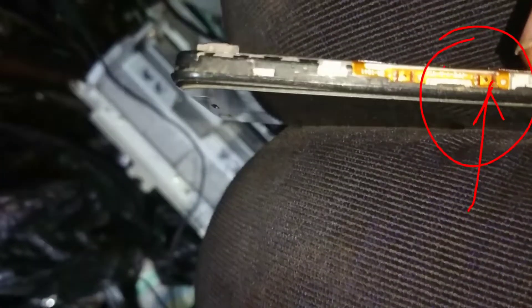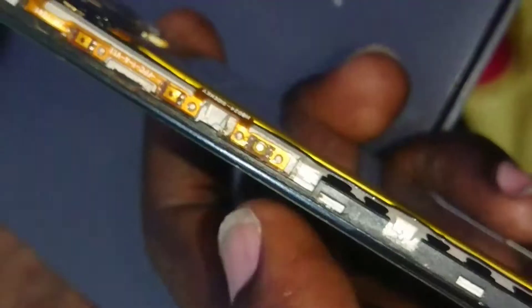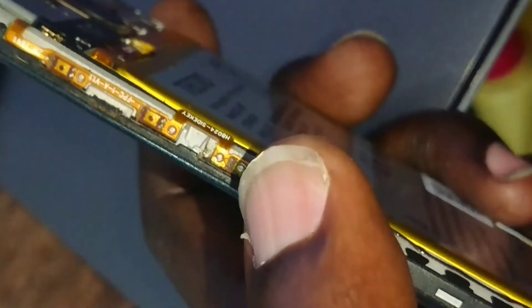I'm going to peel off this metal cap — and the cap is off. That's what it leaves behind, so we are cleaning underneath it. Now I've plugged in and I don't feel the vibration or powering-on anymore, and it shows the charging icon, which it wouldn't do before. This is solved — that was the pressed power button issue.